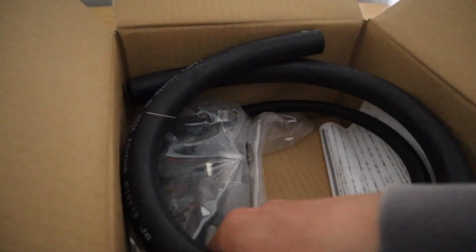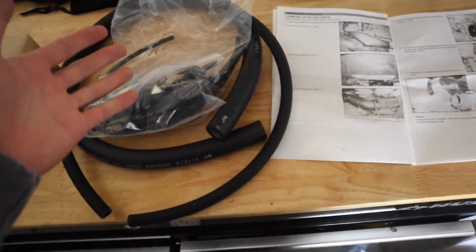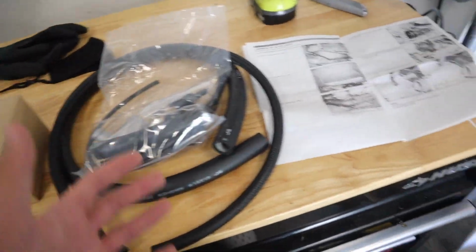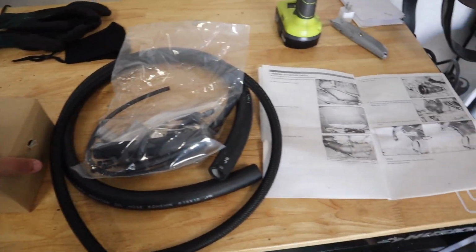More hoses. So guys, this right here is an HKS Super Sequential V4 blow-off valve. Unfortunately, it is the recirculating one. It is not the high-pitched squeal blow-off that the WRXs are pretty much known for, just that super sick blow-off noise. But since we're not tuned on speed density, we can't do that. So we have to go recirculating, which will make a nice turbo flutter.